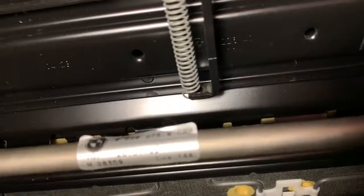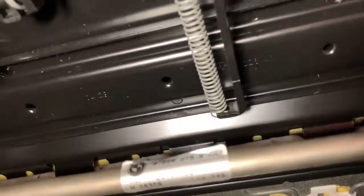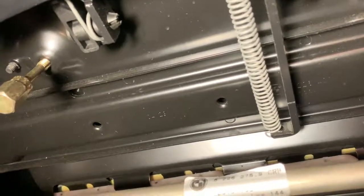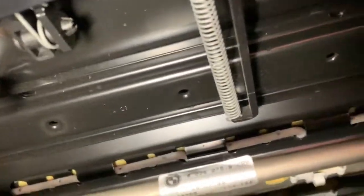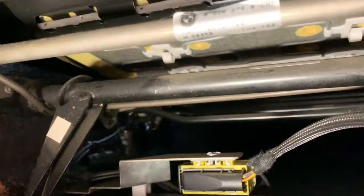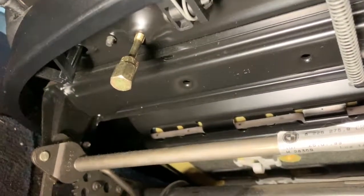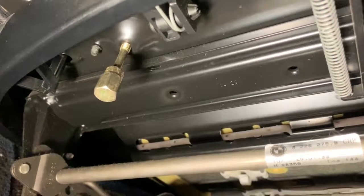I am tapping this with the seat in the car. Saw a couple of people mention that to get that tap up in there, you have to unbolt the seat and tip it back — you can leave the airbag harness down there on the floor connected if you do that. If you are going to disconnect that airbag harness, you will want to disconnect the battery as well. Otherwise your airbag light will come on. So I'm going to finish tapping that.